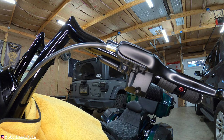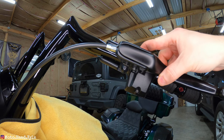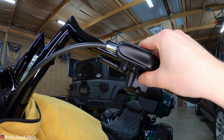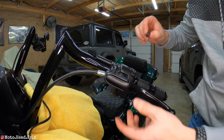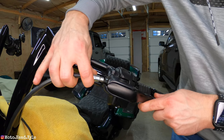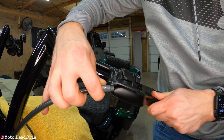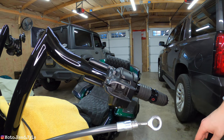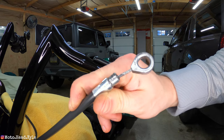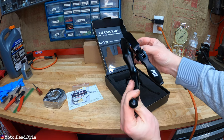I got the clip off. What I did is push the pin down a little bit and was able to get the flat tip right in there and pop the clip right off. Now pop the pin out — make sure you save it. For the clutch cable, work it right out. This top pin just pulls out so you can remove the clutch cable. Also, while you have the clutch cable out, it's a good idea to drop some Harley lube in there and re-lubricate your clutch cable.